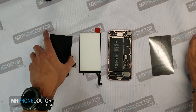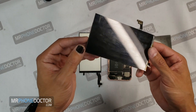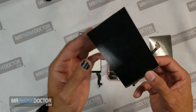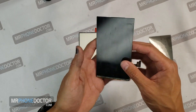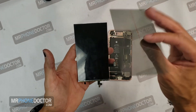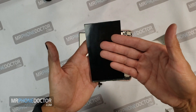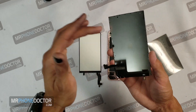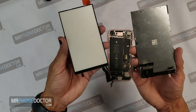Now let's step back into the lab and get this dissected. So this is the LCD that we are going to be working with — it is an iPhone 7. I am going to go into further detail and dissect the layers that are used to assemble this display. The top layer is the polarizer, the layer underneath the polarizer is the LCD, and the final bottom layer is the backlight. I do have a brand new backlight here.